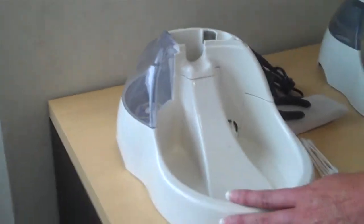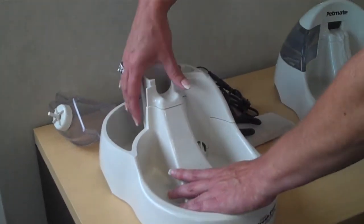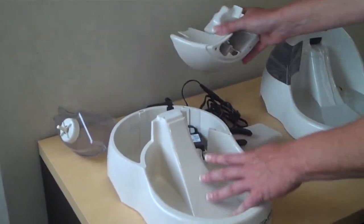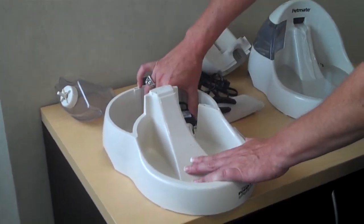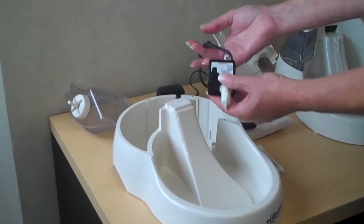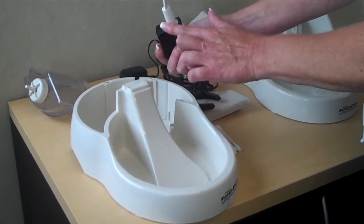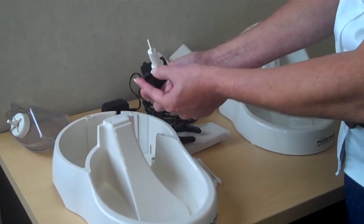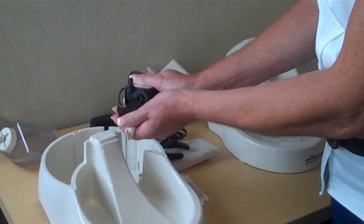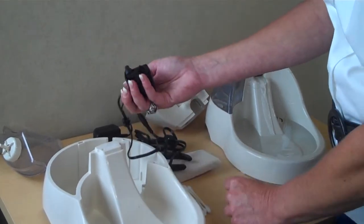This is an empty water fountain — I've taken the lid off. You're going to remove the reservoir and then just grasp the pump right here and pull this top portion off. This is going to expose where the pump sits inside. You'll just take the pump out — definitely make sure it's unplugged first. Then you're going to see this area here may have pet hair buildup, food particles, or whatever, so you're going to want to gently pull that off. If it's clogged, rinse it.